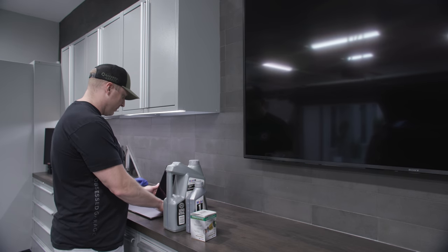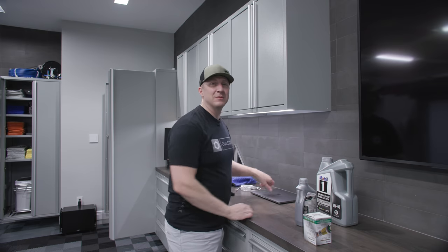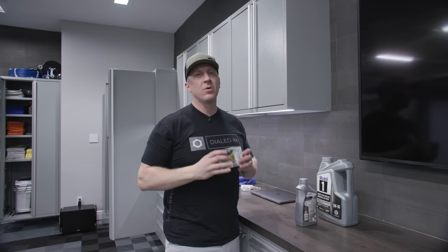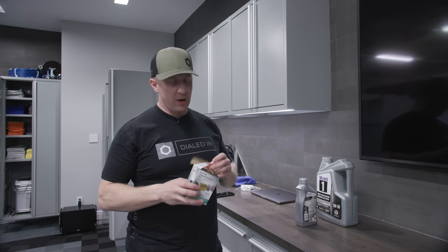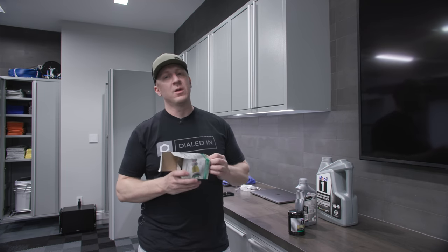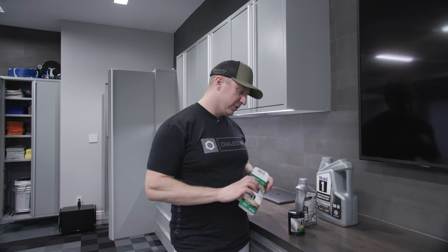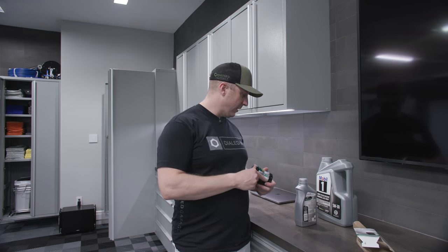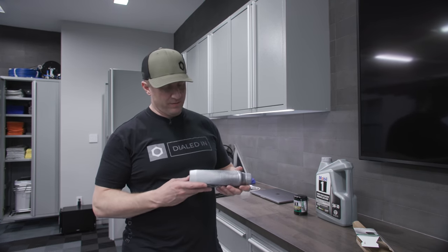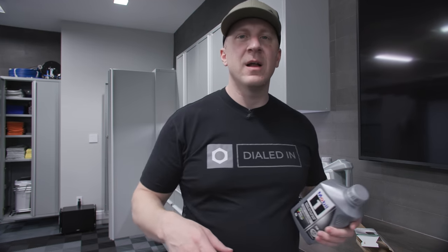I've got a meeting I'm already late on — working on developing an Obsessed Garage app for Inside the Hex, wouldn't that be sick? I had to go to the store. Supply chain issues — we're having some real problems. I couldn't find a Ford filter, so I had to buy a Mobil 1 filter. I always like to use OE filters. I usually prefer AMSOIL, but I didn't have any 5W30 on me, so we're just doing Mobil 1 — keep it simple. Six quarts and a filter.